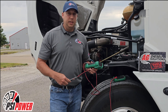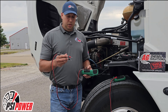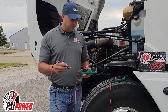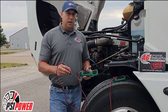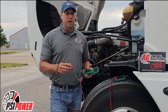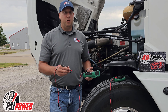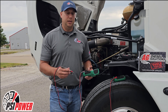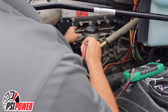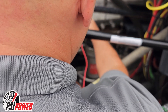To test these coils, you'll need to start the truck, have it idling, and have access to the coils. Put the ground lead on your voltmeter on one side of the terminal and the red lead on the other side, with your setting on DC voltage. Once on DC voltage, you'll see either a negative or a positive number that's very small. If you have an auto-ranging voltmeter it'll automatically range for you; otherwise you may have to try different ranges until the value shows up so you can see if it's positive or negative.